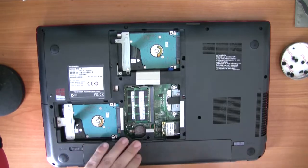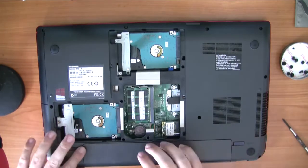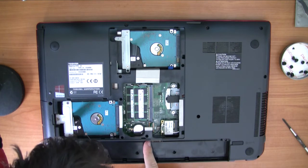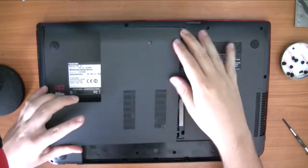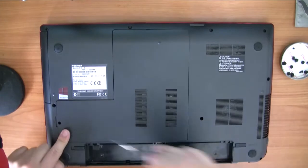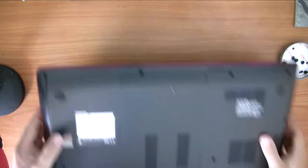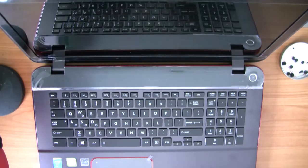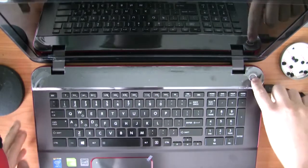I've put the RAM in and also the two hard drives — they're kept in pretty easy with sliding tabs and guards so you won't mix up which hard drive goes where. Also don't forget to put in your BIOS battery. The last thing you'll want to do is put the battery in. I didn't put the Wi-Fi antenna cable together properly, so I'm not going to run it with the battery in — the battery is squishing the cable and I'll have to open the case again later. You don't need to worry about that.